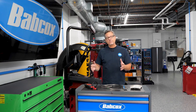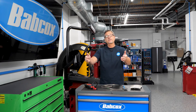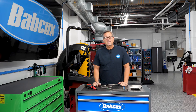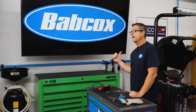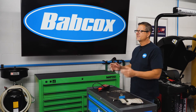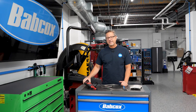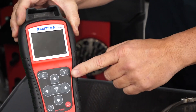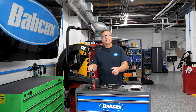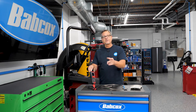So if the alignment shop or a rotation takes place and they take the fronts and put them on the rears, and the rears on the front of the car, all those readings are going to be wrong — that's not the right tire, because you moved the tire. So what do you have to do? You can get on the internet sometimes — they have some key on, key off procedures, or adjusting the air in and out of the tires — or shops will just use a scan tool like this. You can actually go around and shoot each one of the tire locations, and that communicates to the computer of the car where it is, so it knows it's the right front. Then the dash says it's the right front, so when a tire is going down, you've got the right tire.